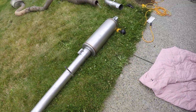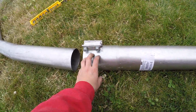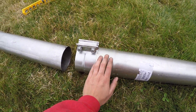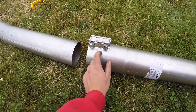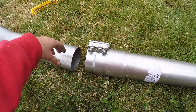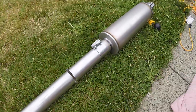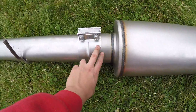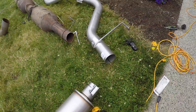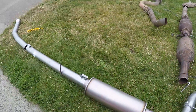Before you install the exhaust, you want to pre-fit the little clamps that come with the exhaust. You're going to find a fat end on the exhaust — fit the fat end of the clamp on that side. They're loosely on here so we can take them off as soon as we're ready to put the exhaust in. Skinny side goes in there, and then you go through the rest of the exhaust and do the same thing — fat side, skinny side — so you have a good layout of how everything is going to look before you install.